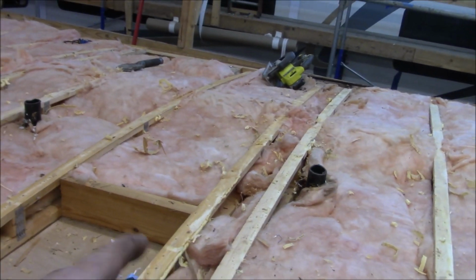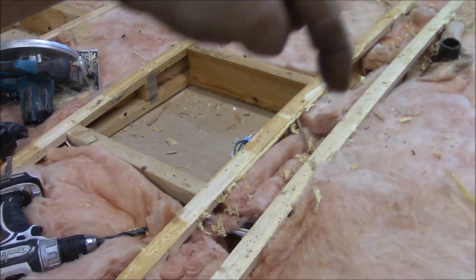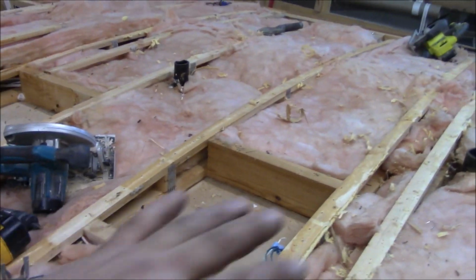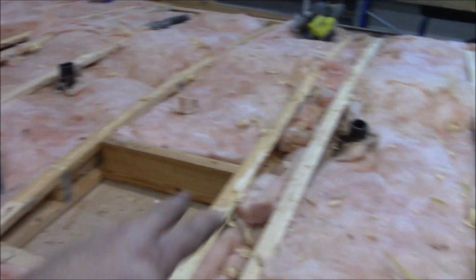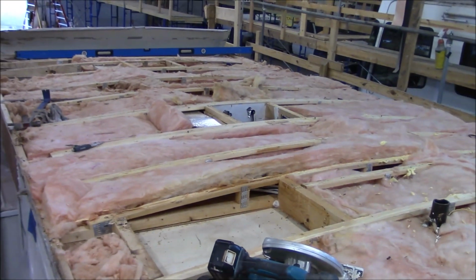And the other thing is they don't nearly put as many fasteners either. What they've been doing is putting one screw in the middle, one in the end, one in the end, and then they split the middle in the end. So you only get about 5 screws all the way across an 8-foot sheet. And I've run across some that don't even do every single truss either. They only do a couple, mainly where they meet. Maybe one here in the middle, and that's it. They don't do them all. So they're really trying to just, whatever they can absolutely get away with to give you the cheapest, shoddiest thing to save them a few more cents, they'll do it.